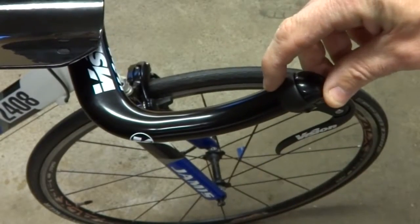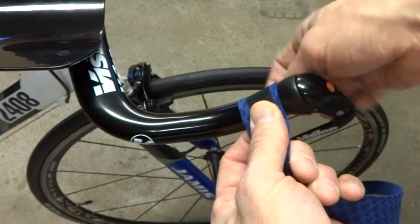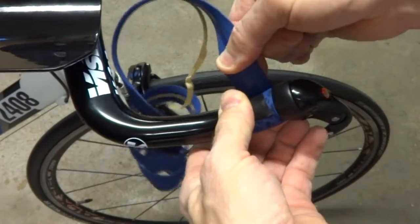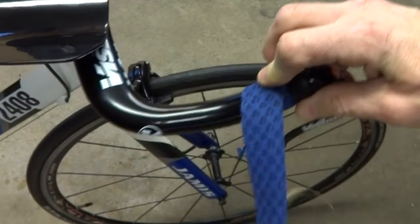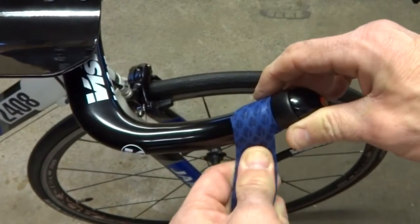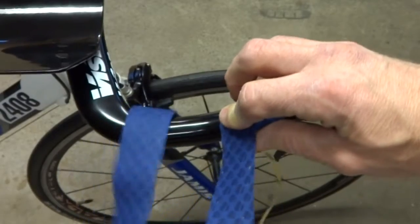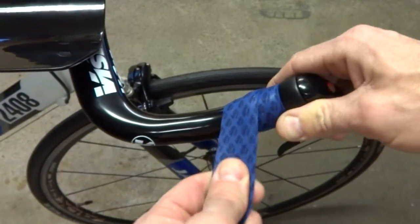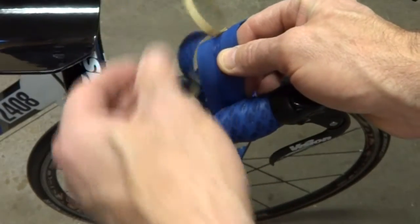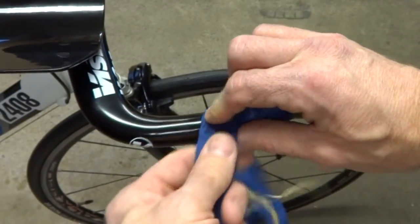Same as before — at the bottom of the brake lever, I'm going to have the tape flush up against the bottom of the brake lever. I've got a little bit of electrical tape to start it there. I'm going to wrap the first wrap completely around over itself, flush up against the bottom of the brake lever, then pull the tape down and wrap down to around the logo here. Once I get the first full wrap, I'm going to start spiraling, overlapping by about a third to a half. I keep pulling the little backing off the inside so it sticks. Some tapes have adhesive on the back; some have a rubbery material that helps it adhere to the bars.